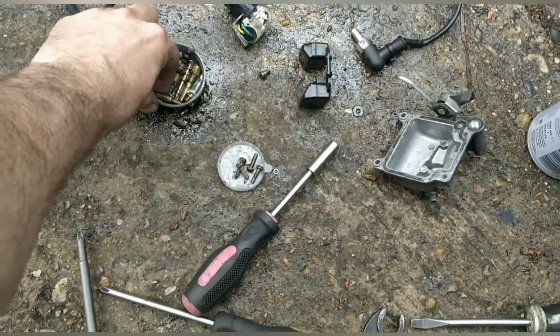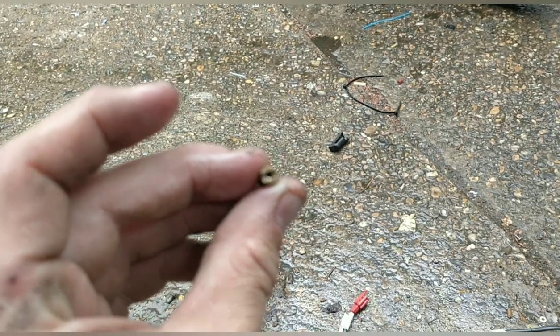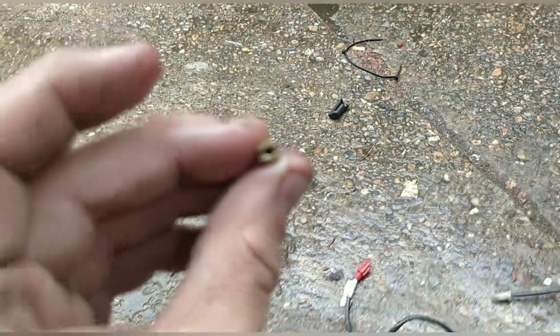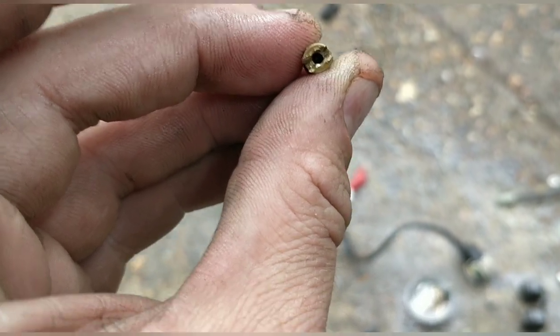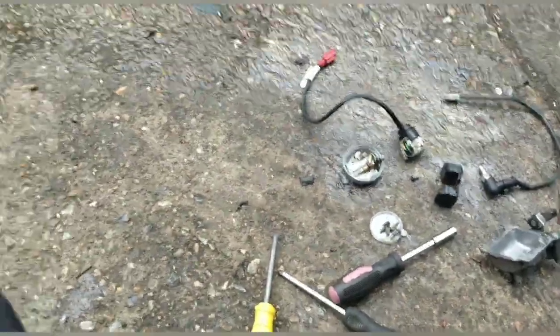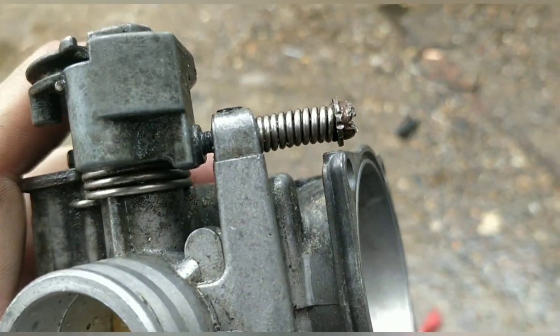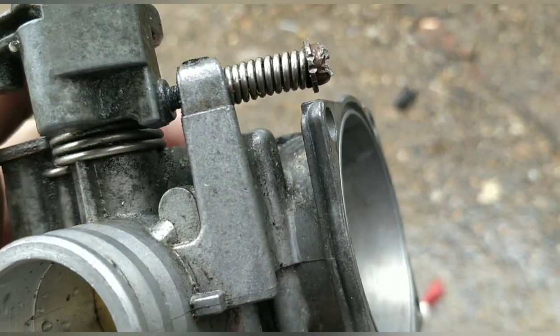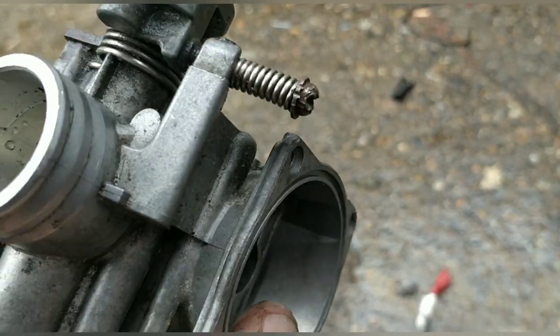Even looking into all the jets — it's just hacked and almost looks like it's been drilled. That is a 35. So it's just not a happy carb. I'm going to give it a thorough clean and then go back to putting that on next week to see if we've got it good to go. The idle adjustment is seized solid — absolutely doesn't move. Got to get some WD on that and try and loosen it up because you can't adjust the idle.